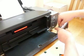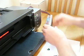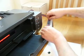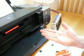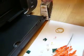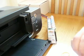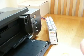The next stage: we're going to remove all the small plugs on top of the continuous ink system — all eight of them. Because I've straightened the cables, there are no twists at all. Before you remove these plugs, if you've got any twists, get them out first. So all eight plugs have been removed. Now we have air filters here — they've got a thin pointy end and a stubby fat end. The stubby fat end has to go down first with the pointed end upwards. I'm going to install all eight of these.